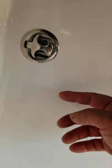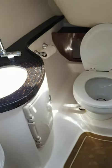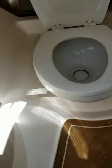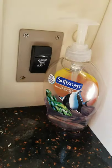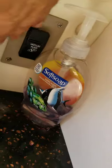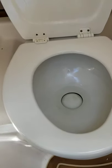In the restroom — the latch is on the bottom. Reach over, lift this up and pull it open. You'll have access to your restroom. It's got a vacuum flush system. This is your vacuum switch. Whenever you have the water on and you're ready to flush, go ahead and click this down at the top to turn it on. When you're done, make sure you turn it off or it'll burn that pump up. When it's on, hold this down until the water flushes through, then let it up. Use it with your foot, your hand, your preference. There's toilet paper there, an emergency first aid kit in the bottom drawer, and some cleaning materials and additional toilet paper.